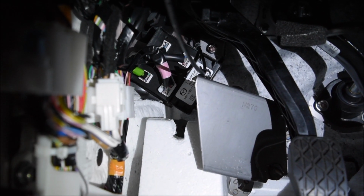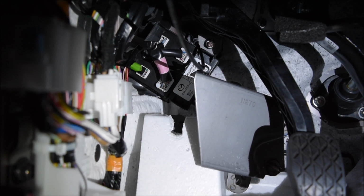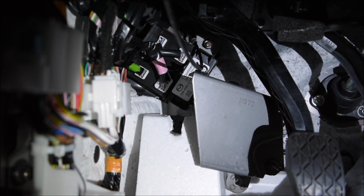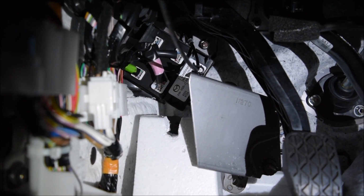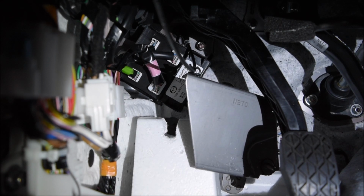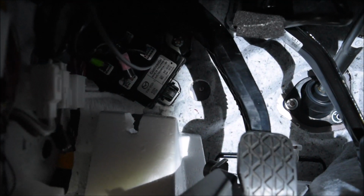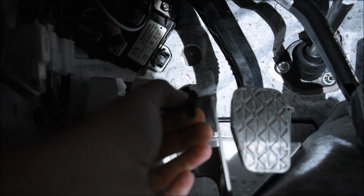I don't know if you'll be able to see this very well, but I pulled the metal cover off. Basically pull it to the right or the inside, depending on which side you're working on. There is a cable. The hood release is actually connected to the top corner of that metal plate, so I couldn't pull it off without removing that. And I say that, but you can't see right there. I hope that focused. The side's open. So, there's the metal plate out of the way.